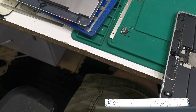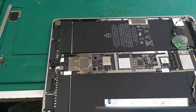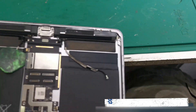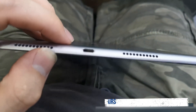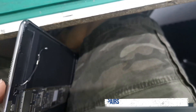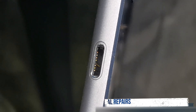As you can see the screen is over here — I've already removed it safely. Let's check what's happening with it. Just on visual inspection we can see that it is perfectly fine, up until the point that we get a damaged pin. We can clearly see in the charging port that there is one broken pin. This means that the charging flex needs to get replaced.